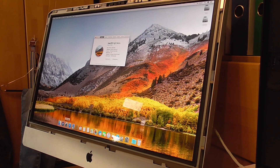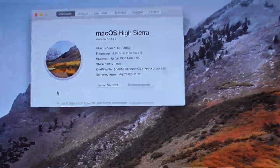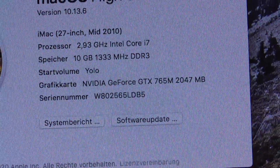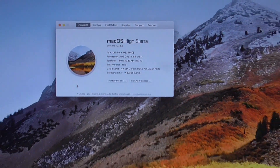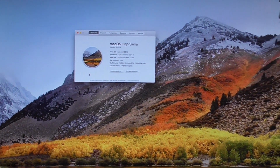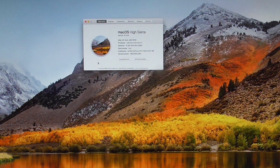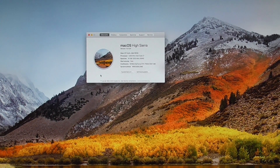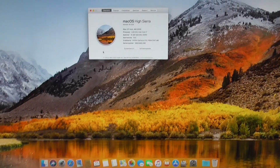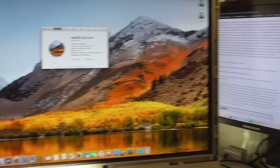Let me get that GPU in here and hope that it boots, then we'll start the more tedious stuff. The old one is out. The new one's in. The GTX 765M works in macOS without any issues. Now comes the exciting part — let's boot this into Windows. First, hope that it boots. I purposely didn't install any drivers just to minimize problems, and then we'll flash it.